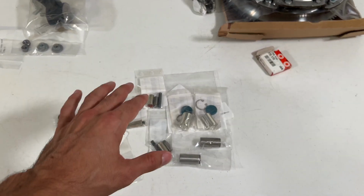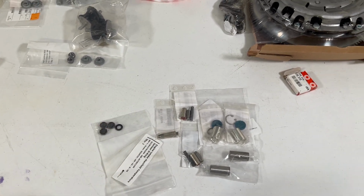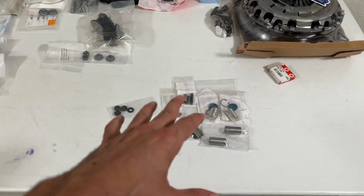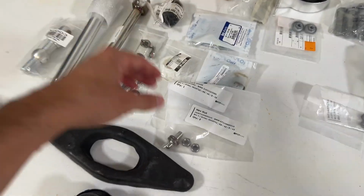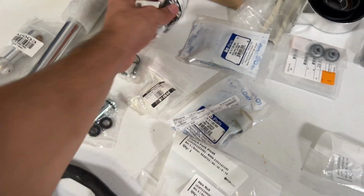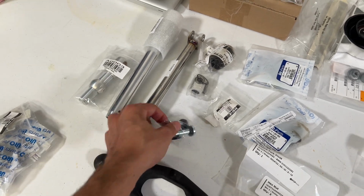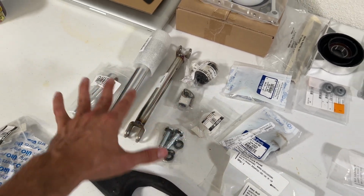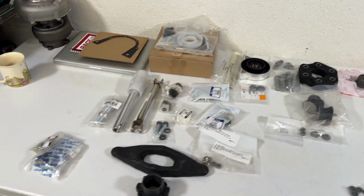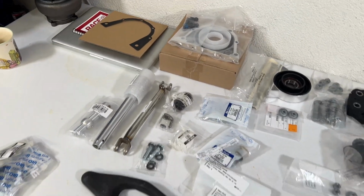So that alone changes the feel of the transmission because you're literally changing the internal actuators of the transmission itself. Just doing this job is going to increase the feel. You're going to get the feedback from the transmission. So to pair this with the short shift kit, with an entire rebuilt set of bushing components, all of these pieces here, upgraded bushings there, a new DSSR definitely tightens up the shifting linkages. Everything here is a strengthening, higher upgraded component, plus the detent pins. This transmission is going to feel literally like I said in the first episode, I want it to feel like a DTM race car, boys.